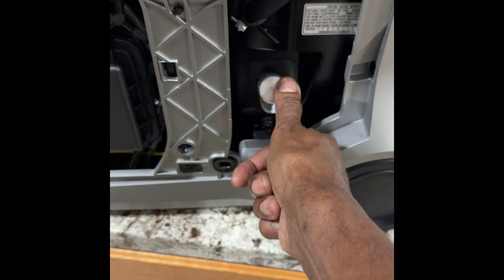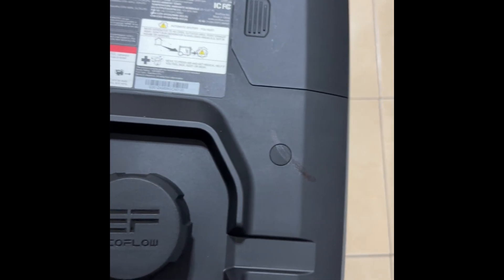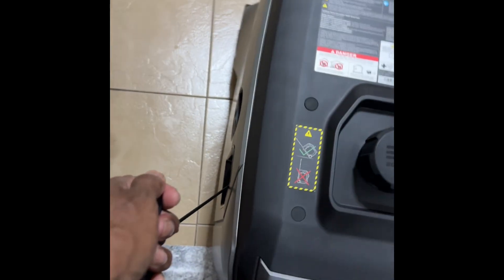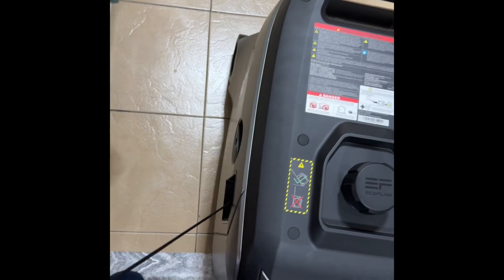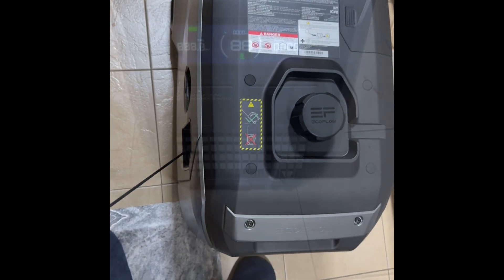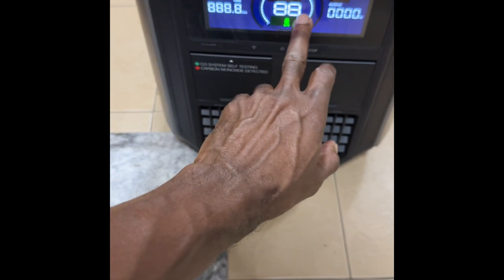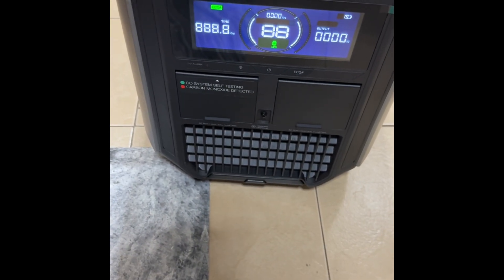The magnetic stick is in. I'm going to close the unit up. Now that I have the unit closed back up and dropped the lube into the spark plug hole, I want to pull on the crank a couple of times to get the lube and the oil flowing in the engine — it tells you to do it in the manual. Now with the propane connected, this goes all the way to 888. So most likely this is a good unit.